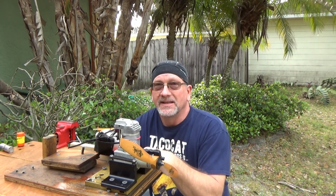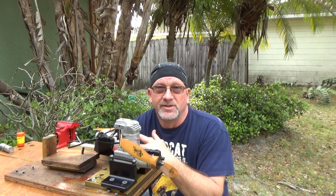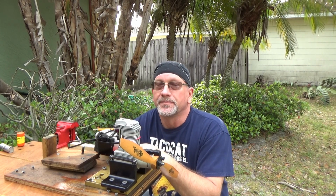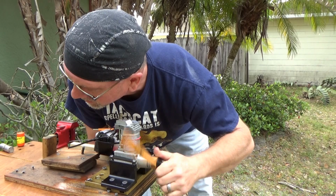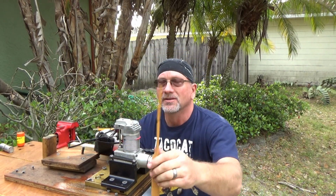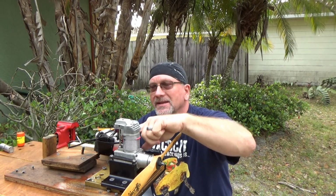I did not see any kind of signs of leakage from this glow plug at all this time, which is a good thing, because before the last run I saw fuel coming out there. I don't see any evidence of leakage there this time, although I might still hear a little bit of air leakage. This carb is leaking,